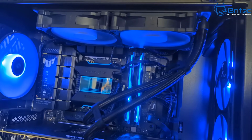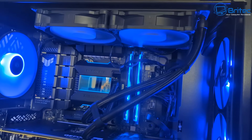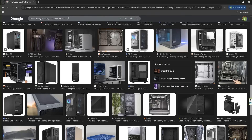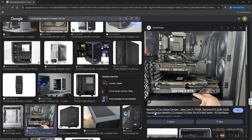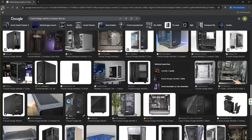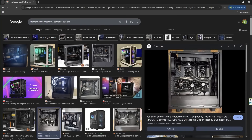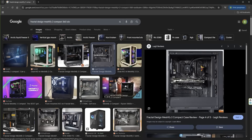Always do your checks before you purchase any components for your next build, because you could run into issues — and some of these 360mm all-in-one liquid coolers are pretty expensive. I did a search for Fractal Design Meshify 2 Compact 360 all-in-one and found images of 360mm rads fitted in the front with the fans, but you can see it's very, very close to that RTX 3080. You can search for that graphics card and find out its length, and find out the length of the cooler. The Corsair one here is only 390-odd millimetres — that's probably about the limit. Check to make sure all your specifications fit using images you find online.